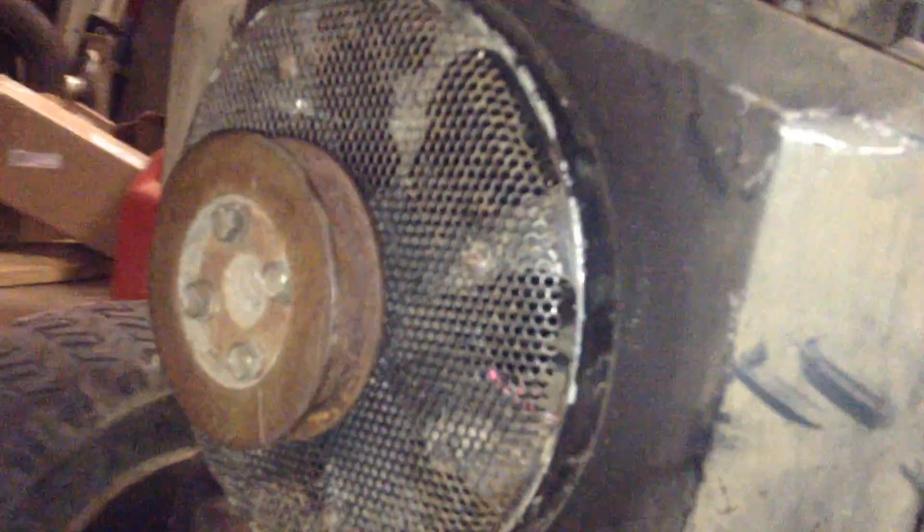What I've got to do is take off the pulley and the hub. Then I have this airflow piece for a little extra cooling. Since this comes out six inches past the hole, it ends up in this general area, which means this lower rib would have to be notched here. So it's giving me a few issues — either I can hack the grill up a little bit, or I can modify this and take the whole thing off. But I'd really rather keep it because it helps pull extra air in. I know I have to cut these off and move the holes over for the bottom of the grill, because these holes for the grill are actually where the front bolts are pretty much sitting now for the opposing twin engine.